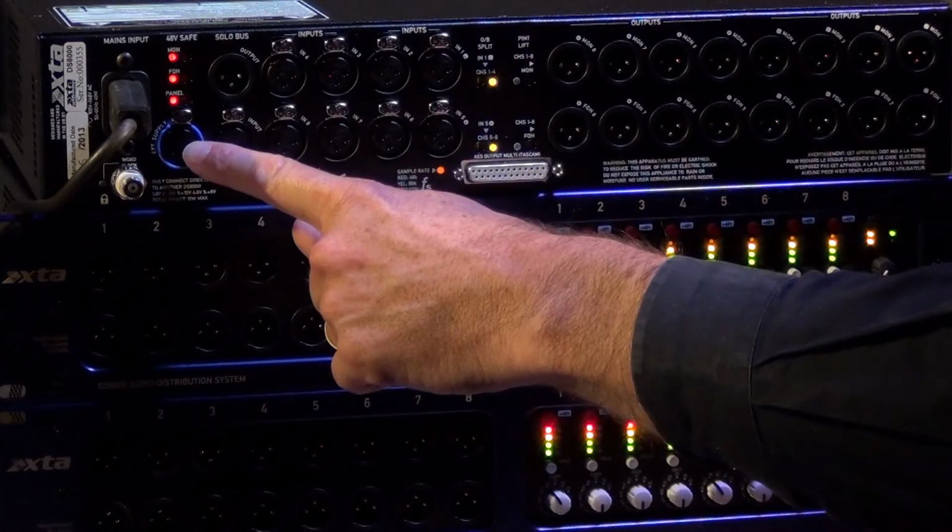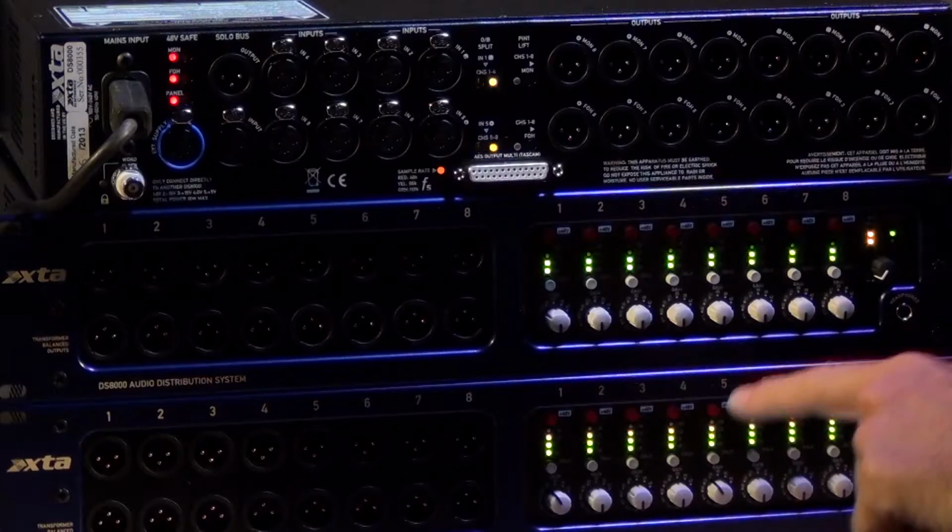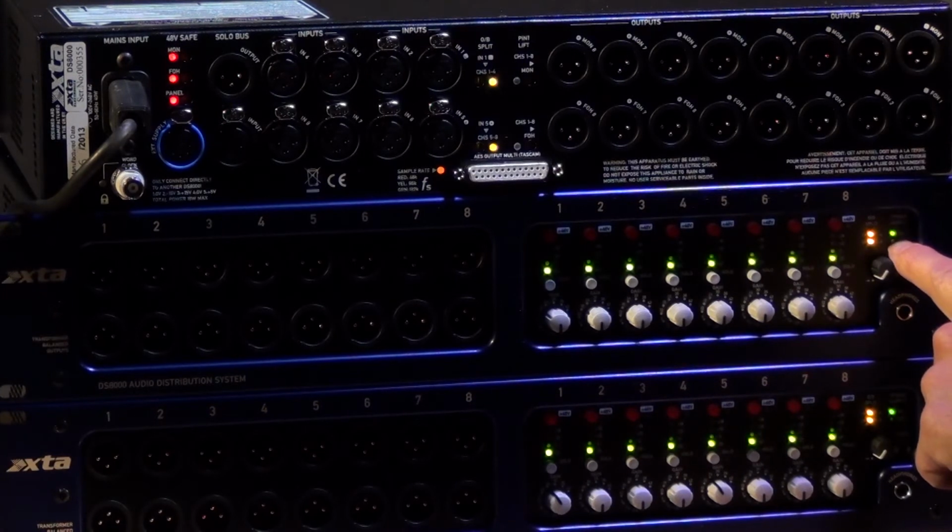That is pretty useful. How does the dual redundant power supply connection work? The supply in the unit is over-spec'd enough to be able to support 2 units worth of power. You connect a buddy link cable here between this socket on 2 units, and if either one's main lead gets knocked out while repatching, the other one silently picks up the ball and both continue to work. The lights on the front panel show how the unit is powered.